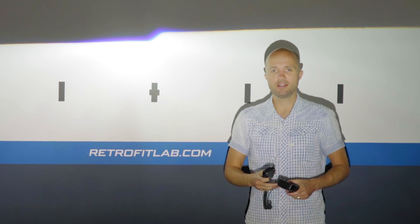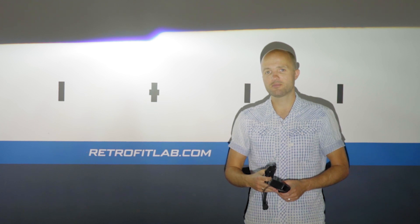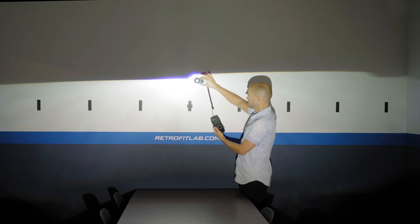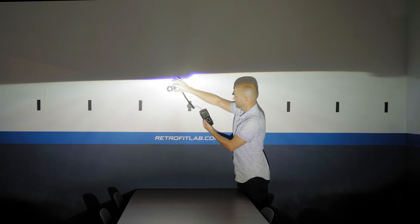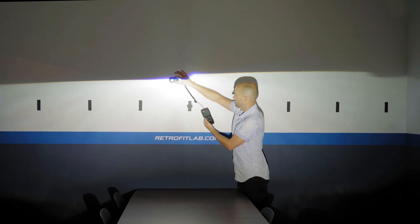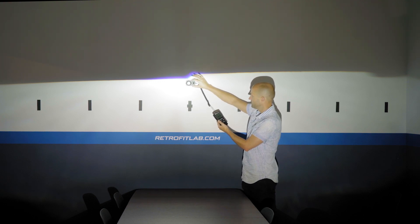Now the moment of truth — the new generation Osram CBI, also called CBN, is installed in the EVO XR 2.0 projector and warmed up. Let's see if it reads almost as high as the Nightbreaker Laser. It comes in at 6.05, then 6.13, then 6.15 kilolux. We see the same pattern as the first test.